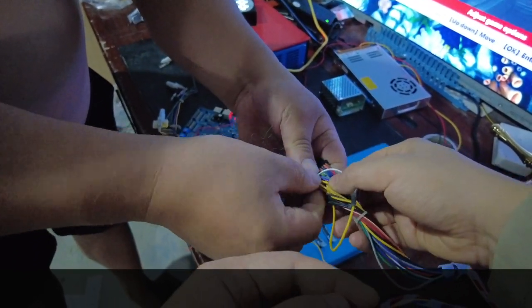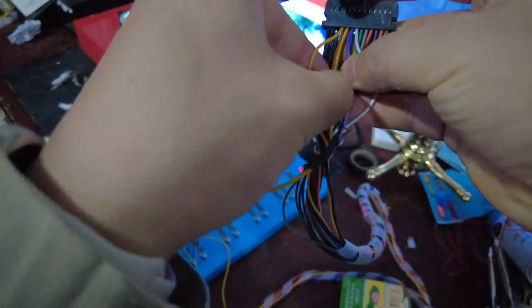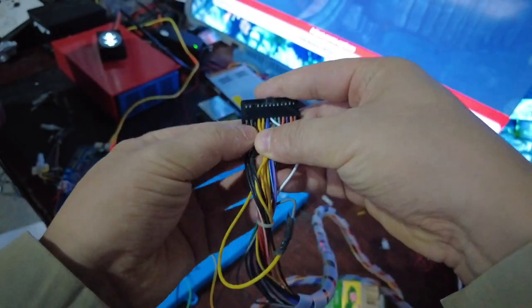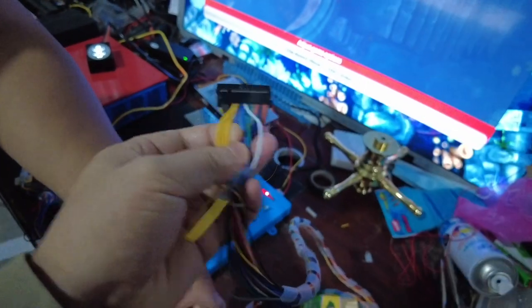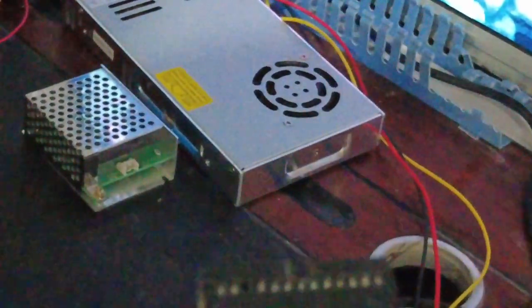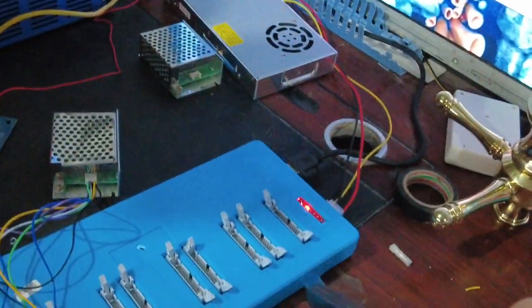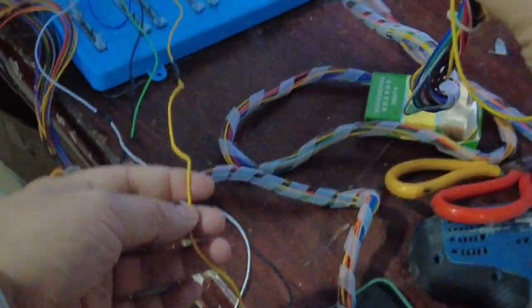The yellow ones have a circle connector. You need to be sure the four yellow cables all have a circle connector. On the harness there are four yellow cables — they should all be 12 volts. If any one of these cables is not 12 volts, it's not going to work. So you are supposed to be sure all the yellow cable is 12 volts, and these 12 volts on the yellow cable must match this one. It's very important.